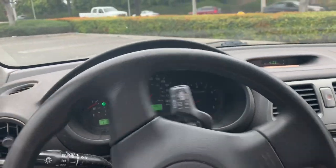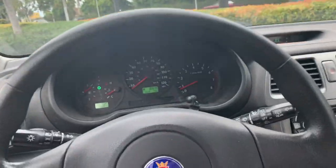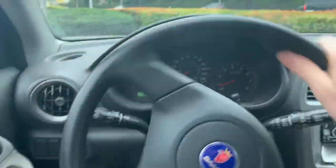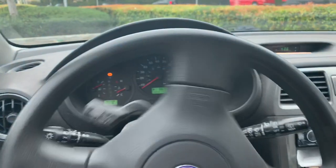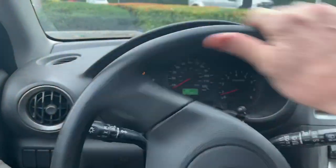You can also look under the car to see if that's the case. Another test you can do to make sure it's not your power steering pump is put her in park. When I'm turning the wheels in park, there's no grindage sound. It's completely quiet because the U-joints aren't turning.